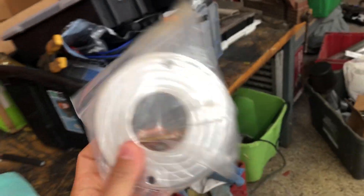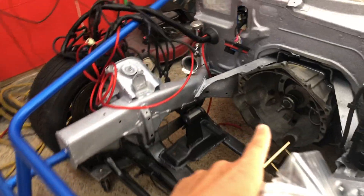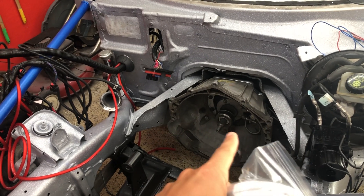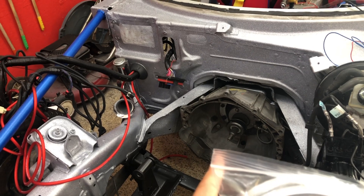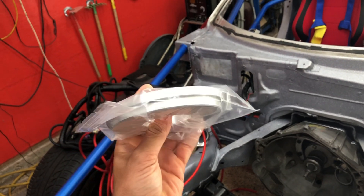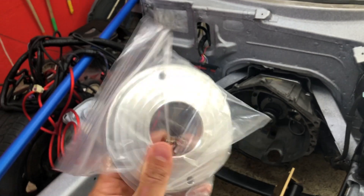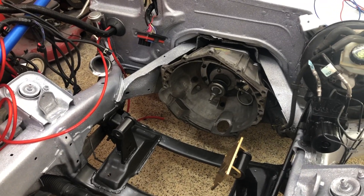The first thing we've got to do today is swap in this new slave cylinder spacer. The original spacer that FabBot had shipped us to be able to use the original AR5 with this 4L60 bell housing was the one they send for a normal LS, and apparently it's about six millimeters too thick. So they sent us for free this one which is six millimeters shorter - this is the slave spacer that is normally used for the Colorado.